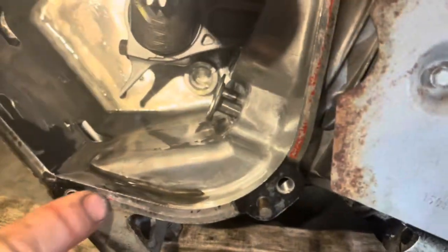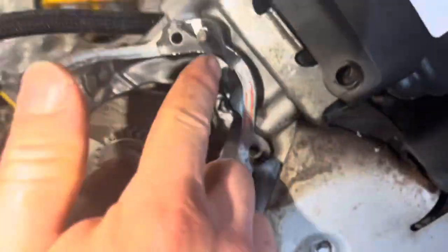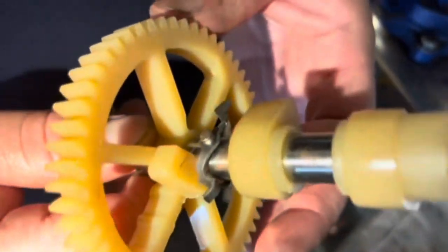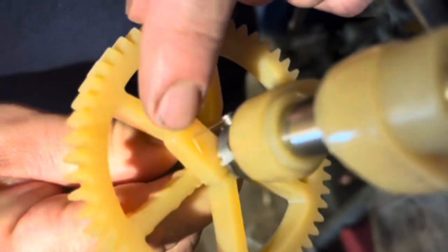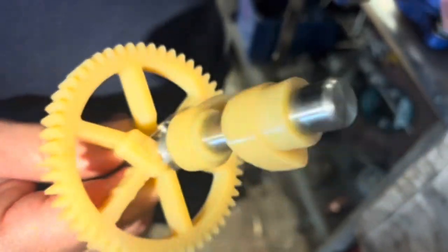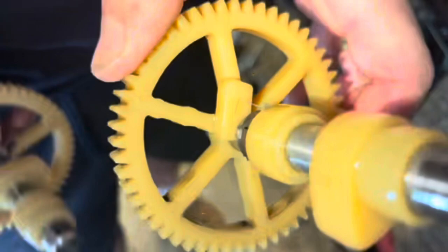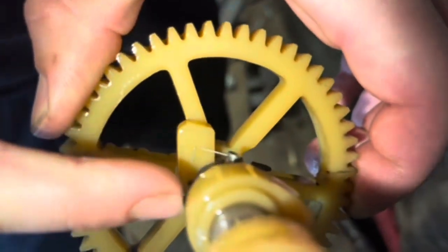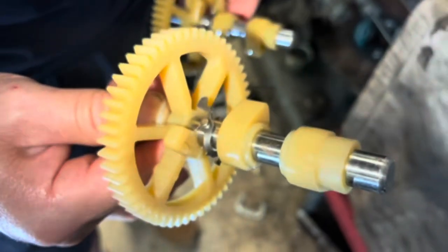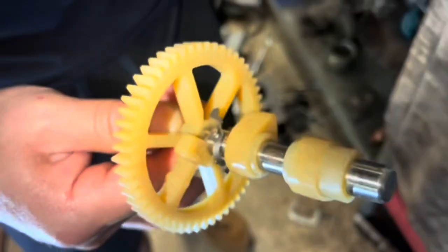This makes the camshaft pretty easy to replace because now I can just go straight back in with the camshaft. But unfortunately off camera we're gonna have to do some work — we're gonna remove all these pieces of the gasket and get a new gasket on here. This is the new camshaft with that compression release with this tiny little spring sitting right behind that shelf there. In a very unnerving fashion, I have the old one and I was able to reset the spring and now the compression release is working again. So does that mean this one's gonna come off in a couple hours? Let's hope it doesn't.